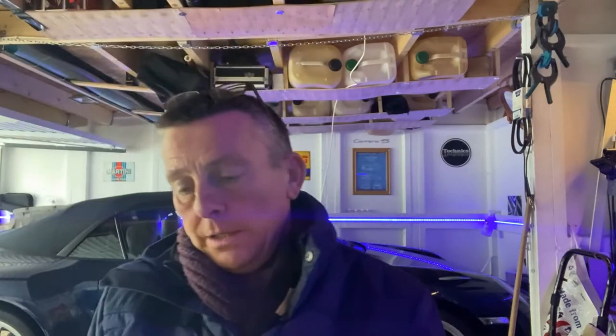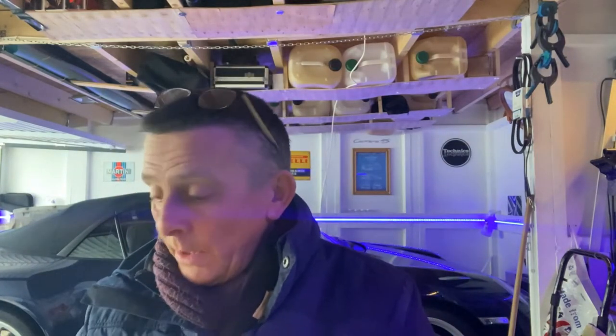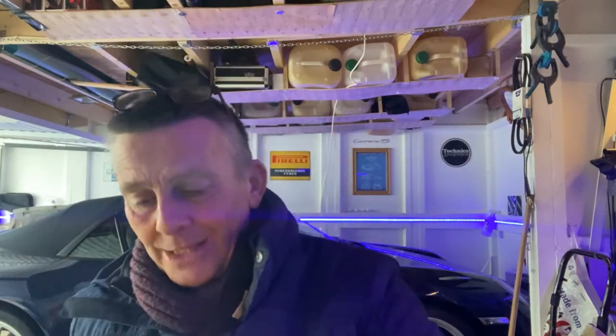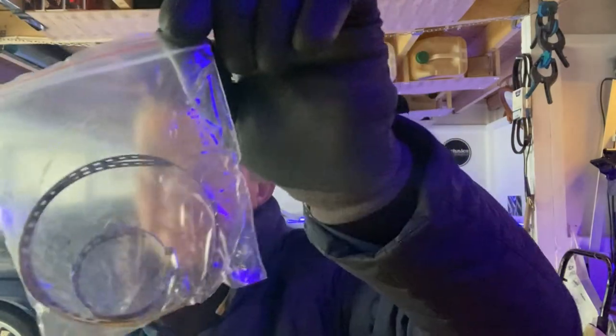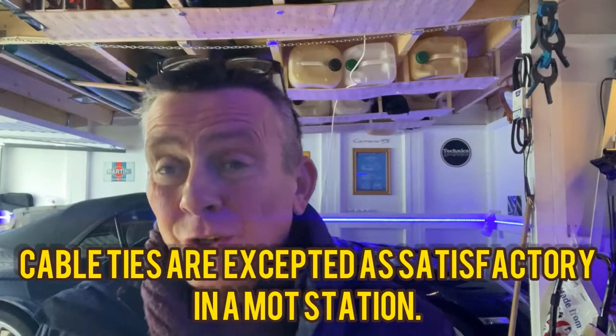Now in your boot kit, that's the Bowcast, the DBC 300, comes a flexible boot, a sachet of grease, and a couple of clips. Make your own decision about these clips. I used cable ties on the other side and doubled up on them as well, because I just couldn't get it tight enough, in my opinion.